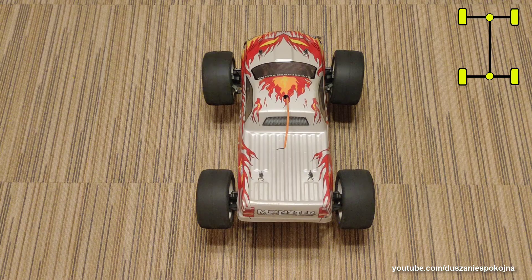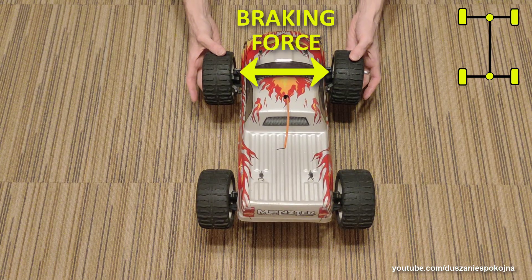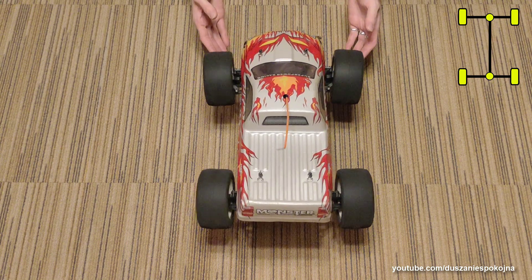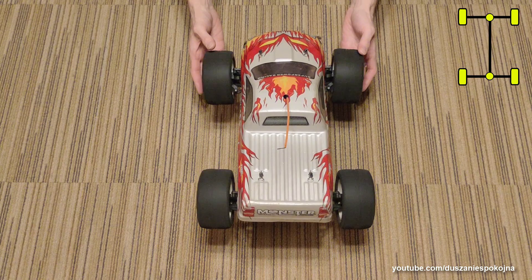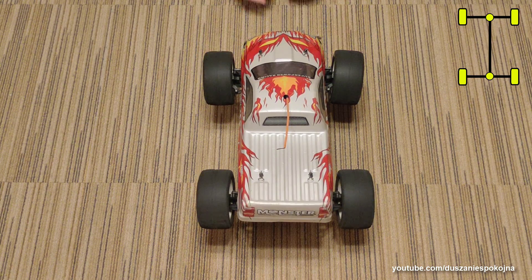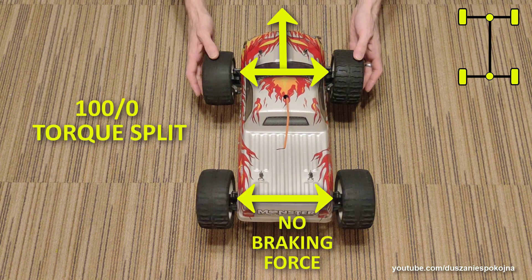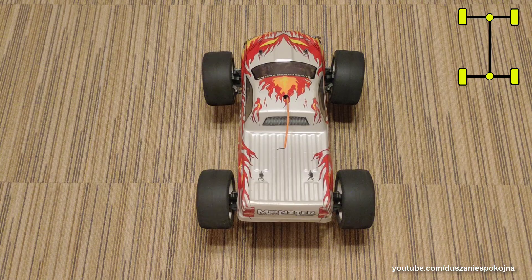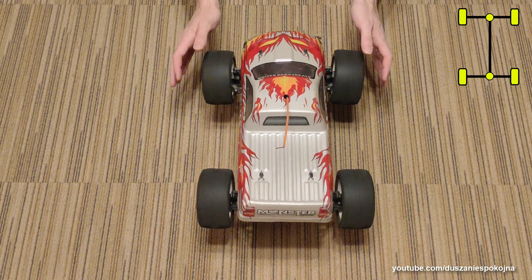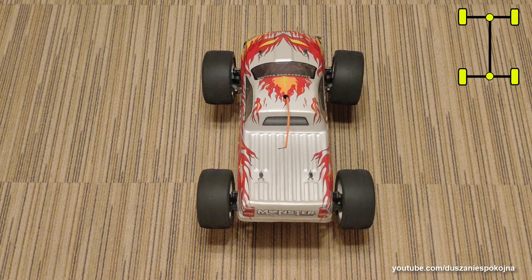Compare that to a locked differential. We apply the braking force to the front axle and the system stops. All the torque is applied to the axle held by hands. No braking force needs to be applied to the rear axle. The braking force applied only to the front axle prevents the rear from spinning, so 100% of the torque goes to the front. We hope this short presentation has helped you to understand the torque split of open and locked differentials.